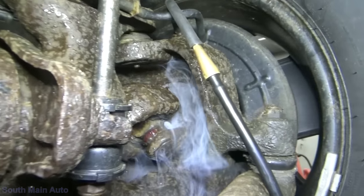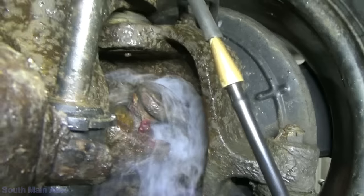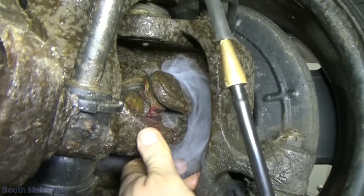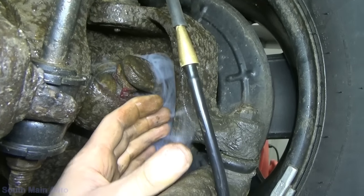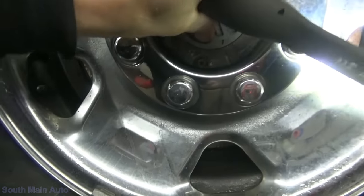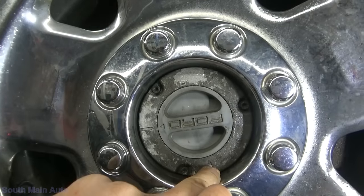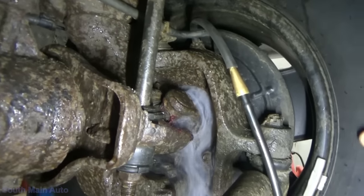We'll look at the outer hub, which looks pretty dry to me. Well, that my friends is the inner hub seal. I'll spin the front shaft here so you can see — it's just bellowing out around there. This is a great big seal that goes in there. The front axle is retained into the wheel bearing with just a snap ring and a washer, so there's a little bit of play in these. There's a center support bearing in the actual wheel bearing on this, and there's a big O-ring that goes around the wheel bearing too. Often if those are leaking we'll see smoke coming out from up front. But being that the seal is puking so bad, we know it's that. We don't see anything coming out around the lockout hub itself. But it looks like the majority of our problem is in there.